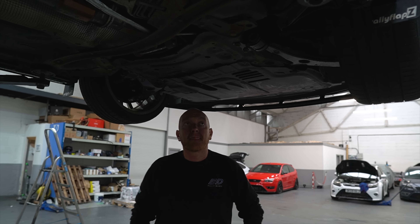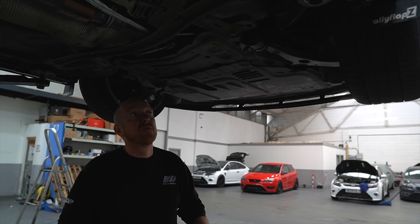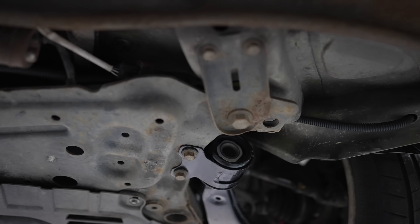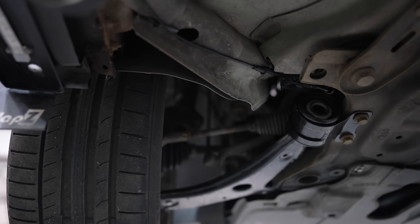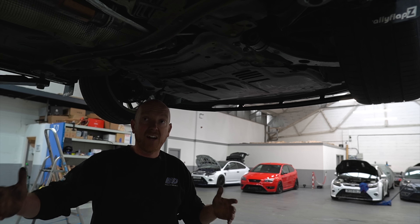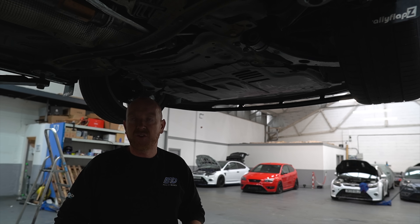Under the car, make sure you avoid any moving parts or anything that gets hot, like the exhaust. In this section we came across the subframe, which meant going a little bit closer to the exhaust than we'd have liked — so we added some extra trunking just for good measure to ensure no issues in the future. For the battery, the transmitter is tucked right in behind the battery box itself — as far away from the engine as possible, and away from weather coming through the front grills. So it's nicely tucked away from both heat and rain.